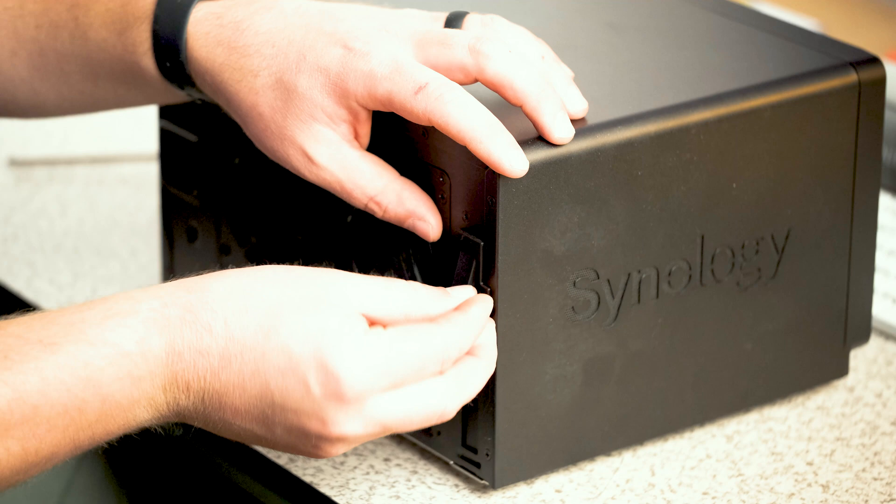Now that we know what's involved, let's talk about the plan. First, we'll take the network card and insert it into the NAS to give it 10 gigabit capability. From there, we'll get the computer hooked up to the 10 gig adapter and make sure that's connecting. Then we'll bring the NAS into the picture. I'm not going to go through the NAS configuration process in detail in this video since I covered it in our previous photo storage video — I'll link it in the description. Let's get started and we'll check back in once things are configured.